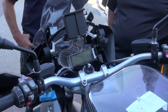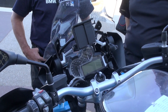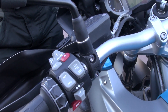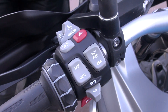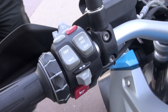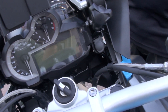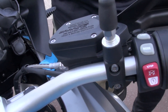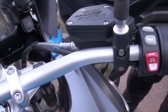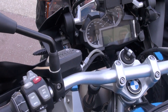Turning the thing off by the kill switch to retain everything — how long is safe? It doesn't use a lot of power because it kills the main beam. I'd recommend it when you're stopping to wait for someone — pull over, kill the engine with that, wait 30 seconds or a few minutes. For longer stops, if your bike's a few years old, you're probably better off turning it off at the key. And ESA stays the same when you turn off at the key — it's only the safety systems that return to default.